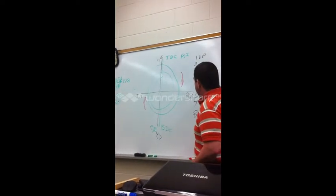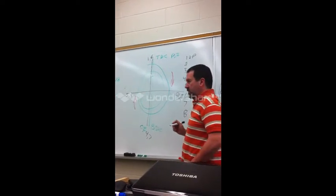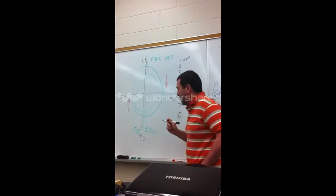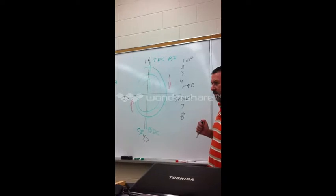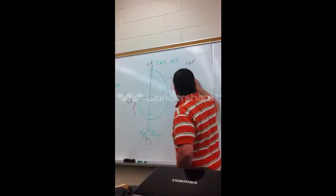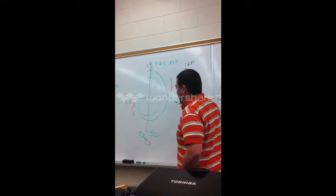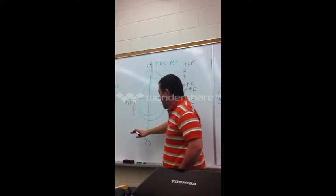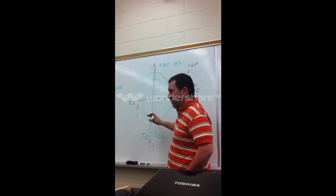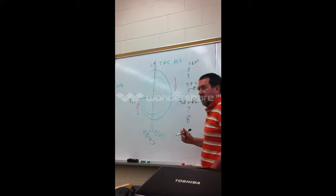What direction is it going? Up. What are the two up strokes? Compression and exhaust. Which one do you want to pick? Compression. It's going up on compression. Next in the firing order? Four. Going up or coming down? Up, going up on compression. They're both on compression because a stroke is traveling from BDC to TDC or TDC to BDC. It's 180 degrees, but these are how far apart? 90 degrees, so they're both on the same stroke.